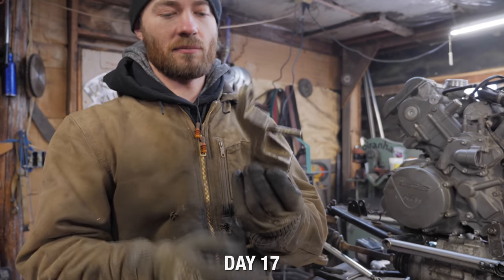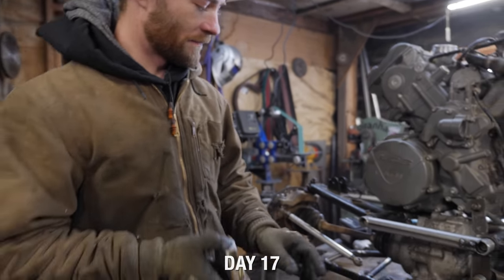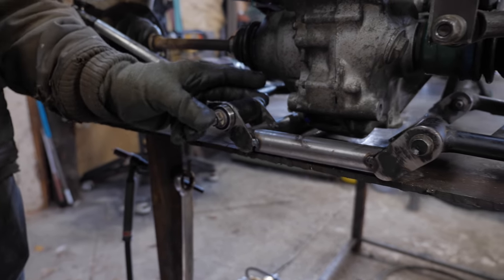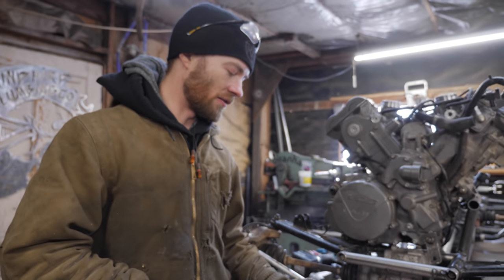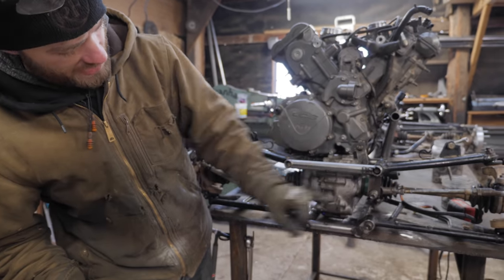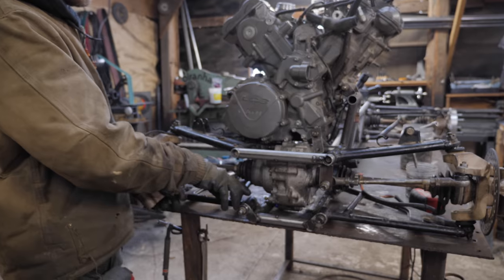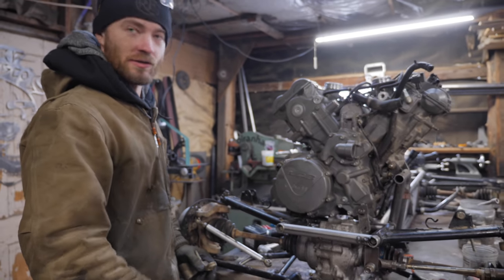These are some steering arms from the old Polaris Predator 500, and I'm not going to use any of the arms, but I took the bearings out of one of them, and they fit over this bolt with a little bit of expansion on the inside. So now that's going to be the steering pivot, the same as the suspension pivot. Now I just need to make some little sleeves in the lathe that fit nice and snug over those bearings. Then I can weld to those sleeves and make my steering arm come up exactly as high as that, and then figure out where it's going to be pushed on by the other thing. The cool part is it just goes right over this pivot, so just take the bolt out and lift it off to take it all apart. Multi-purpose. Oh yeah, that's so cool. Yeah, no new mounts required.